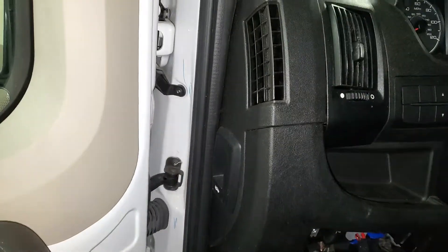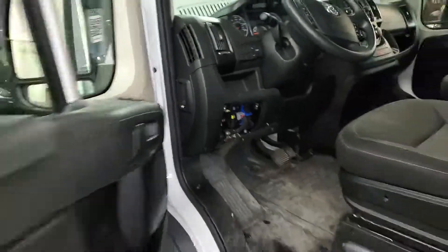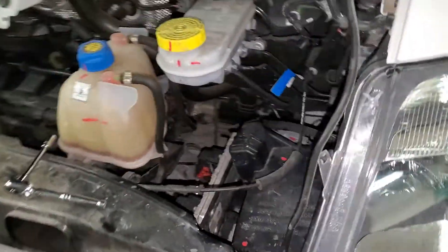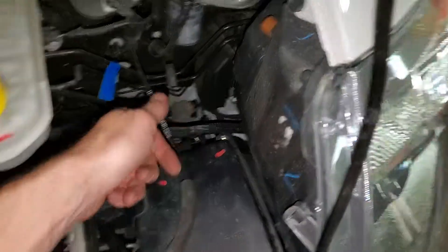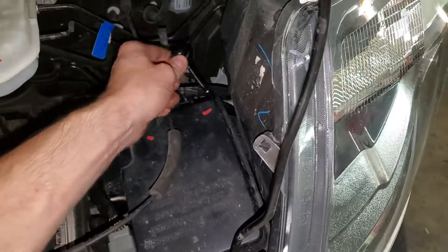Now there are more important ones arguably, so you pop the hood. More fuses are in here. In order to get this out you'll need an 8 millimeter to remove that nut as well as this one right here — I'll show you what that looks like.